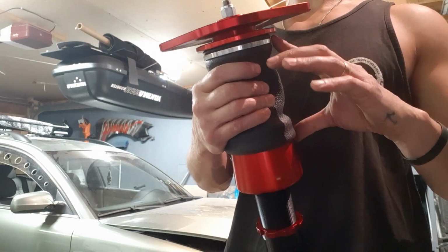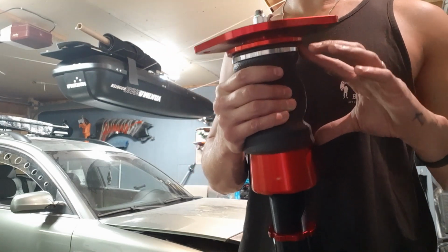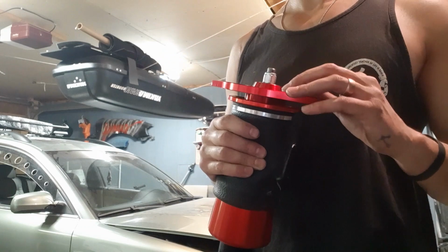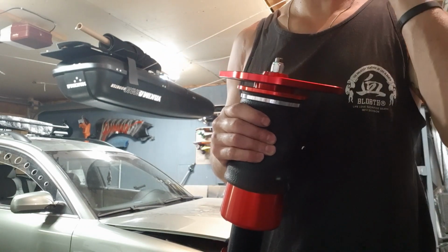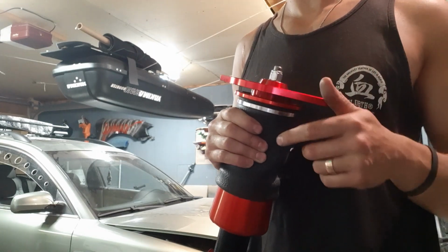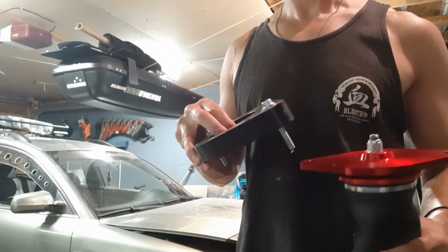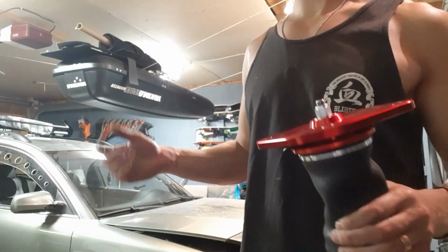So when you're talking about volume here and going from 45 psi to 90 psi, once installed on the car, you're going to see maybe quarter to a half-inch lift. If you're like me and you like to ride around town high or go up into the mountains to do some snowboarding or something, you're definitely going to want to retain that lift as well as have that ability to go low or drop it to the ground. So Dan's application here is going to help you retain that functionality, and it will definitely help you keep that low as well. So I can attest to that.